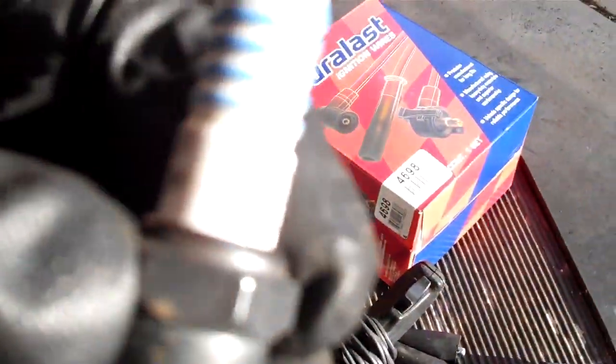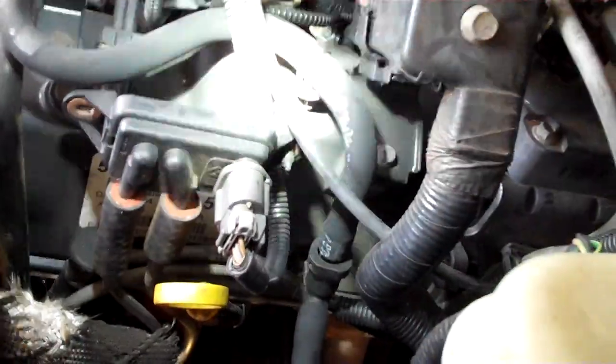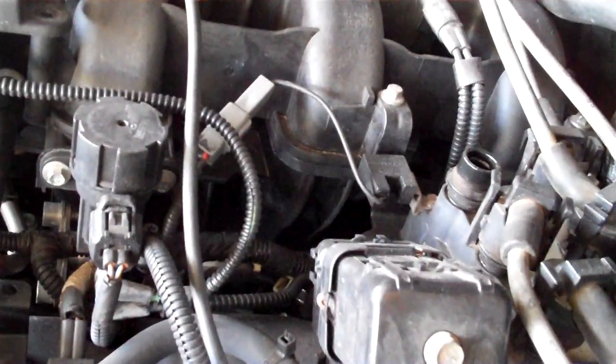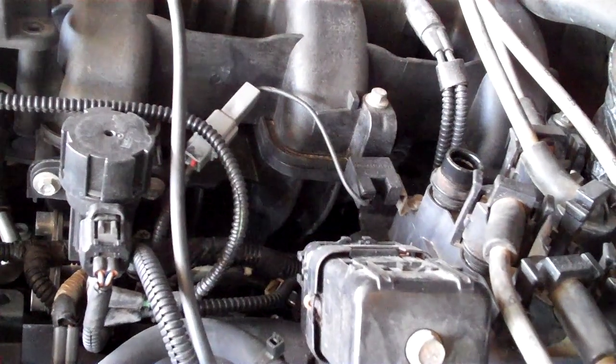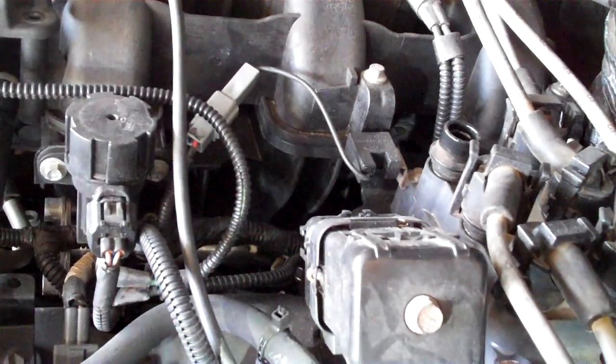This is how we diagnose it — and it's not what we'd like to find. I'd rather it be something like a cracked porcelain on a spark plug, maybe a big black carbon track down the side. I like those because you just change the plug and it's easy. As it is, we're going to have to pull the valve cover, and to do that we've got to pull all this mess off. Then I'll look specifically at the intake valves on the intake manifold side to see if one is bent or not closing fully. Since there's no engine noise, I think it's just not seating properly, so I'm going to have to pull the cylinder head on this side and do a valve job.